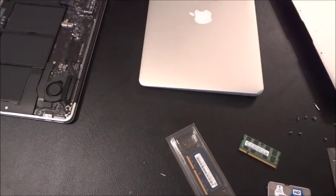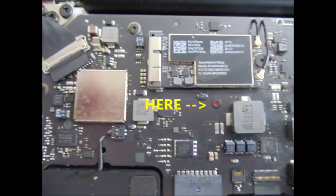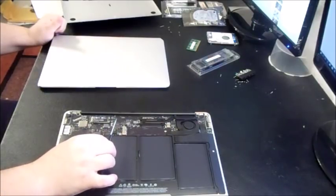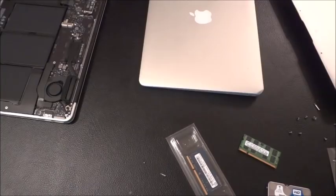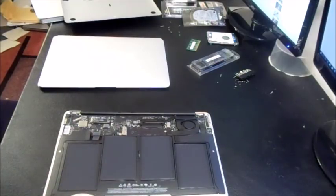I was able to determine this one has water damage — there's a little red indicator that shows water damage and I could actually see corrosion on the board. When you get a MacBook home with visible corrosion, you can go over it with denatured alcohol and a toothbrush, then dry it with a hair dryer and see if you can get it to work again. If it turns on, you can document it and grab the specs — but you do have to disclose that it has water damage.